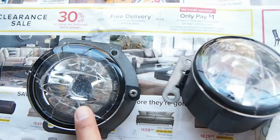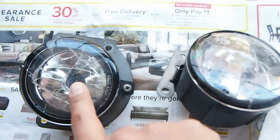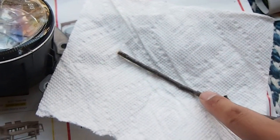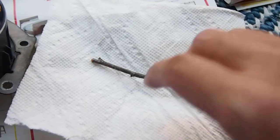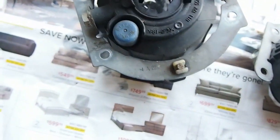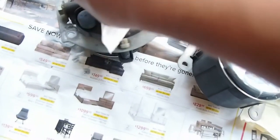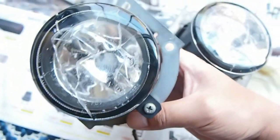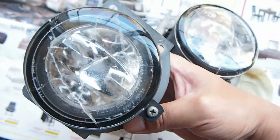And then the way I clean the inside surface and the concave reflector is, well, I brought a twig that is kind of bent, wrapped paper towel around it like that, and then I insert it in there through the opening for the bulb. And when I flip it over, you can see that it comes through on the other side, and then since it's curved, you can just move it around and that will clean all the surface.